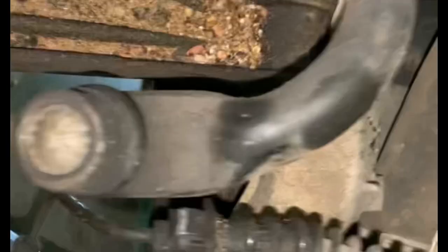Now we move underneath the trunk — we're going to pop off these plastic covers and underneath there'll be three bolts. The old shock is out. You can see my H&R lowering springs. The end of the strut rests down in this hole and you have to take loose the nut that goes through from underneath, which means you also have to take loose this body panel. Once you get that off, you can put a 17 on this side or an 18 on that side and turn it till it comes loose. Just take it loose and that arm will swing down. Once it pivots down far enough for those three bolts to come out, you can compress it a little and swing it out past your fender.